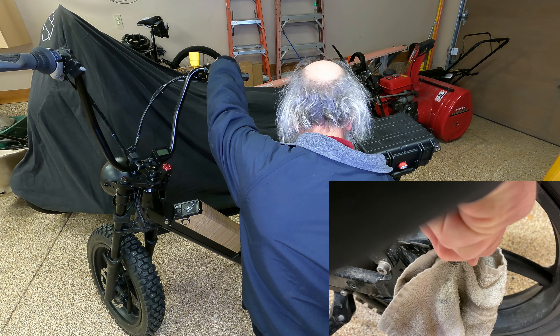This is so damn easy, people. When you're paying a bike shop to do this — there's your screw and washer, goes back on here — can you actually believe you've been paying a shop to do this for you? There's no reason you can't put a badge on the side of your truck and be a mobile bicycle mechanic yourself. Put that screw on there. Wipe up any residual mineral oil. Give the brake lever a couple of squeezes. Now bring your brake lever back up into position, tighten it down, and you're good to go ride with some firm pressure on your brakes.